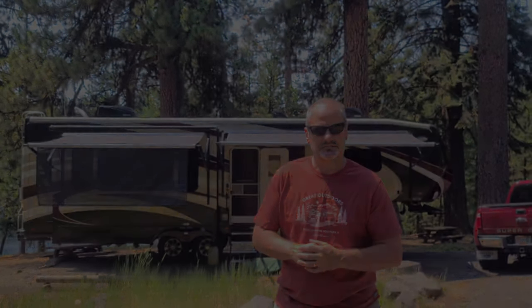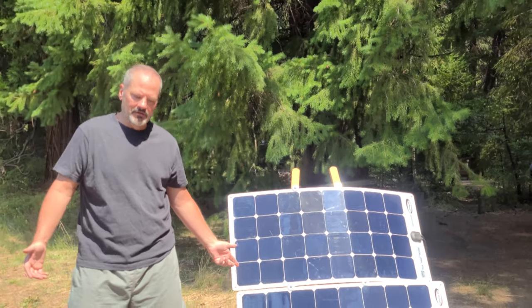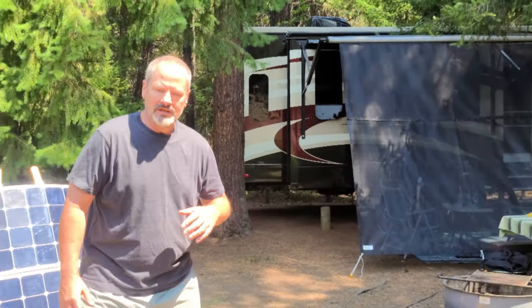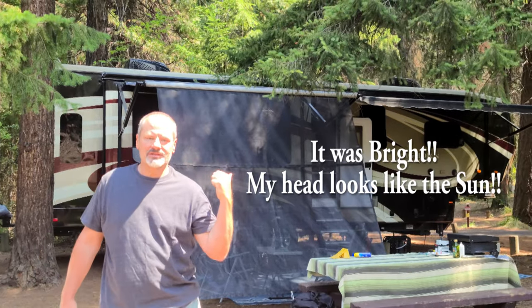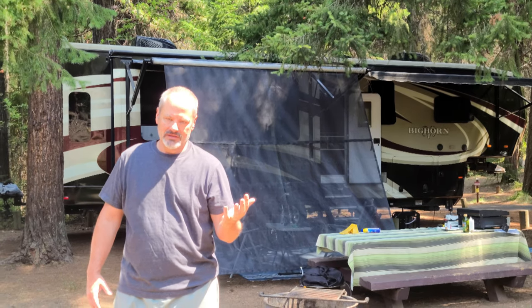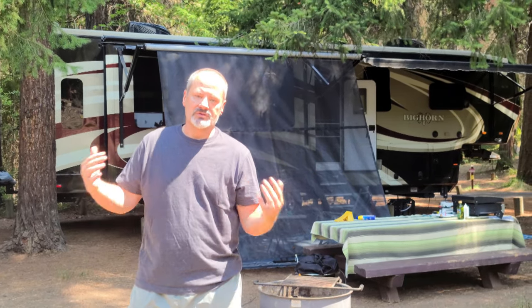But in different locations — like where we're jumping to next — it becomes more important. This is a more typical campground here in Oregon where we camp, and shade is a lot more prevalent, impacting our roof solar. I have my external panel here providing about 200 watts — getting me about 7-9 amps depending on the angle — but as you can see, the roof of the RV is completely in shade all day long. So now you understand why we need a larger battery bank versus more solar on the roof.